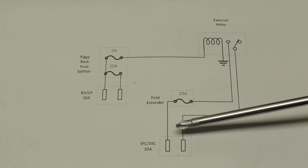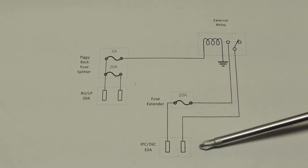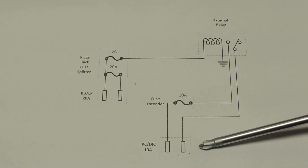When the key is off, there is no power there. You might ask whether there's a reason GM wanted this circuit energized all the time. From what I understand, the parasitic draw problem could emanate from an issue with the cluster — I've seen people have to replace their cluster to get rid of it. It could be something else, but this circuit is also part of the OnStar system. Perhaps GM wanted OnStar on at all times, but I haven't had OnStar active on this vehicle in over 15 years, so it's not an issue.